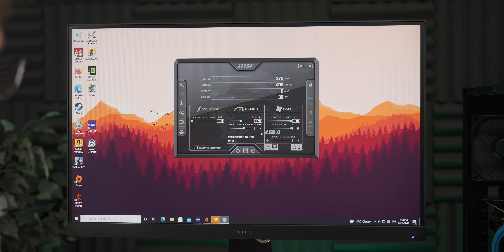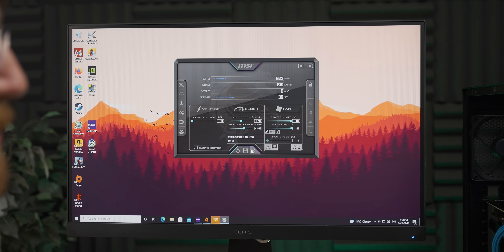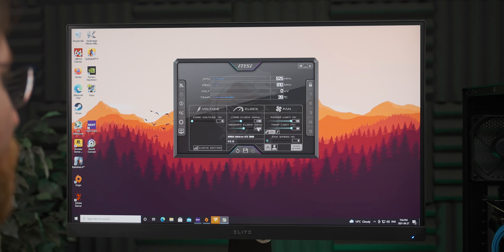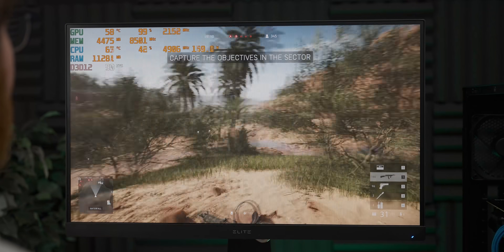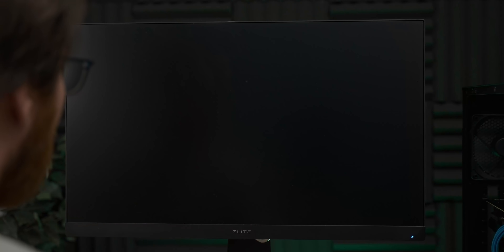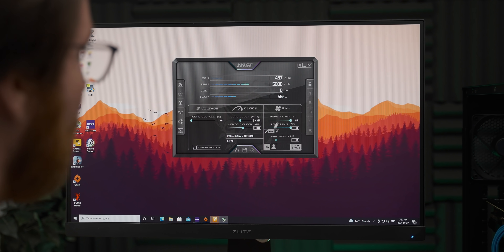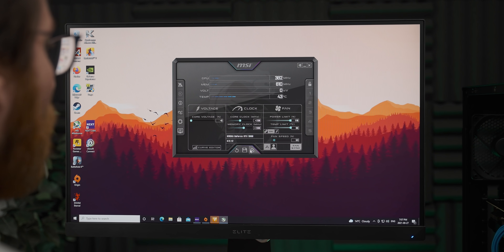When it comes to memory overclock, I'm going to be really brave and start with plus 1000 megahertz. I watched a Jay's Two Cents video on him overclocking a 3060, and he got even higher than that. Plus 1000 seems to have worked no problem. We do need to have some debating range worked into our overclocking expectation here, but let's try 1100 — it seems to be fine.